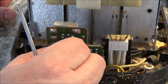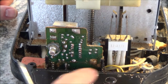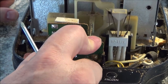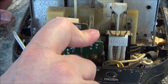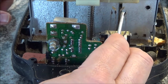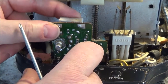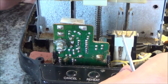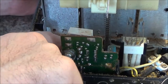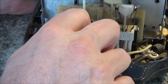The rheostat itself could be a failure point because if it's at its lightest setting perpetually, you're never going to get any toasting at all. I think this is the most likely cause — it's most likely that one or both of those contact points are not making good contact anymore. So I'm going to clean those up. I think I'll just get a bit of sandpaper in there and then plug it in and see if there's any difference. That's really the only bit of maintenance I can see that you could do. Everything else looks pretty good — everything's connected, nothing's broken. All these cables are connected and seemingly where they're supposed to be.